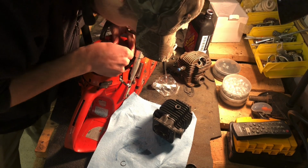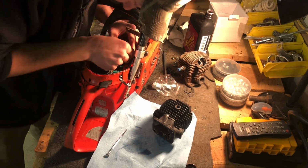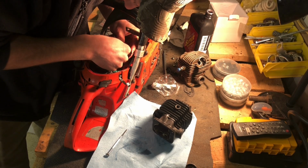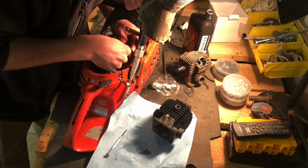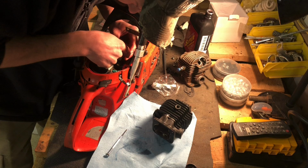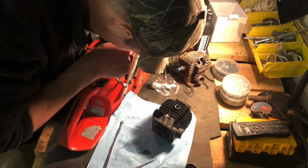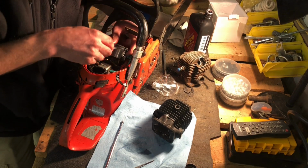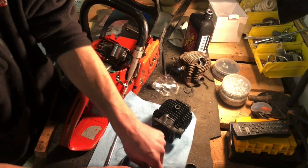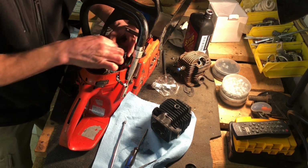Okay. All right, we got the wrist pin slid through. And now we're going to put our last retainer clip in. And these get pretty tricky. You just want to take your time and be delicate with them. And you'll probably see I'll end up dropping it or something. Start on the bottom side there. All right guys, so after about 10 minutes of fooling, I got that second wrist pin in. You want to make sure they're both seated in there nicely. And it's time now, we're going to collapse the ring and slide it up into the cylinder.